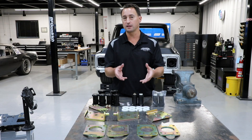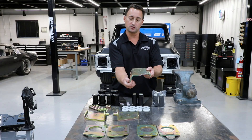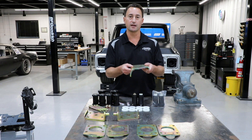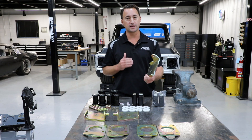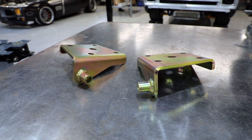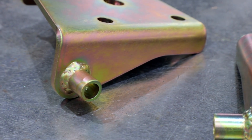We offer a variety of shock plates. This is going to be for your stock shock plate — the shock actually has a stud that bolts into this flange. With the 67 Camaro, the shocks were actually both in front of the axle, so you're going to use a left-hand and a right-hand shock plate. 68 to 81, that's when they staggered them — because it's like a mirror image, you're actually going to use two right-hand plates. If you're using the mini-tub kit, we have different shock plates because you're going to use a different shock — it's actually got a monoball shock with a through-bolt, so we have a little stud welded on to the end of the flange.